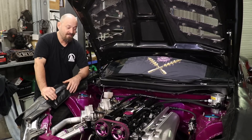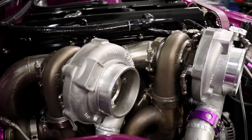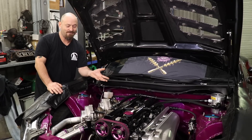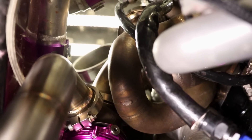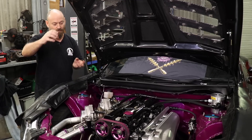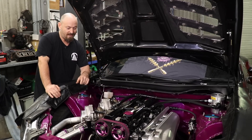On the turbo side we've gone with twin GTX 3071 Garretts with TL exhaust housings. Why twins? Why not — they look really cool. I wanted to hark back to the 90s where Japanese companies like HKS and Trust were building crazy promo cars and often used twin turbos up high. They look pretty menacing and I reckon it looks great. All of it is made on Hypertune Hypex exhaust components — I made it all, but you can buy the cast components, collectors, runners, and bends and piece it together yourself.